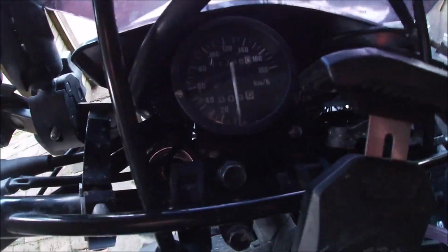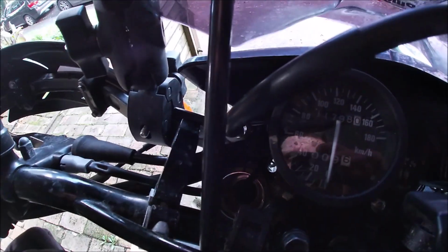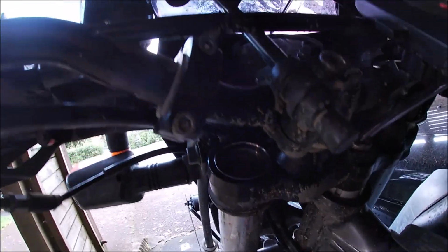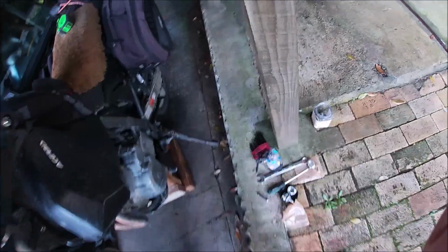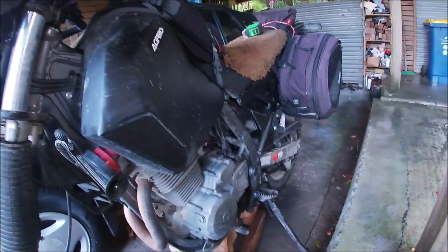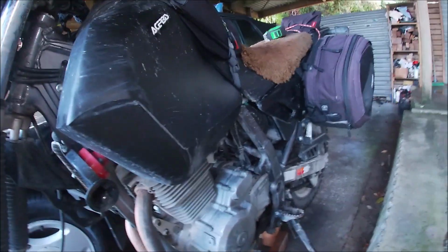Hello my dear friends, let's make a video on the Suzuki DR650 preload caps installation. So you need to lift up your bike, open up your original caps. There you'll find a spacer. Then you would need to be very careful not to drop anything in the fork if you leave it open.